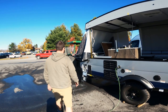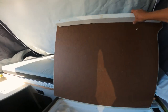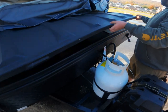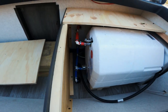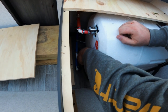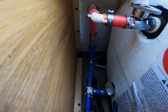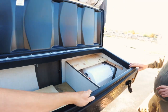We're going to find our water heater bypass. Here you have a pretty standard three-valve bypass — you could have a one-valve, two-valve, or three-valve; this one happens to have a three-valve. What we're going to do is turn our cold line going into the water heater off, turn our hot valve off, and open up our intermediate valve. What that does is instead of circulating the air through the water heater, it now circulates through the hot and cold lines by closing the valves to the water heater and opening the intermediate.